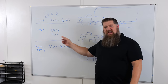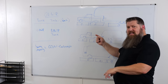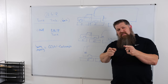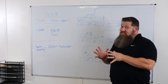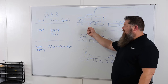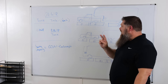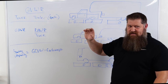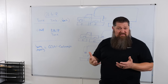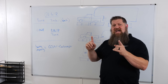Once you have all those numbers written down, take your truck and trailer, go over to a parking spot, disconnect your truck, leave the trailer there, and come back for the re-weigh. Everyone still has to be in the truck and you still need a full tank of gas. Pull in to pad one and pad two — whether it's a fifth wheel or a trailer — and get your second weigh. That second weigh gives you the gross vehicle weight, meaning the actual weight of the truck with all passengers and cargo carrying capacity.